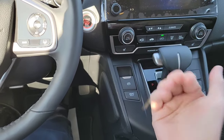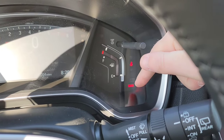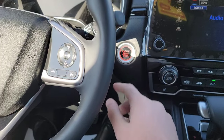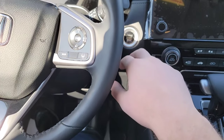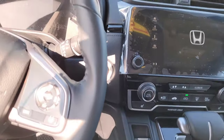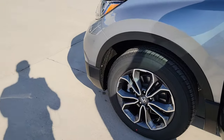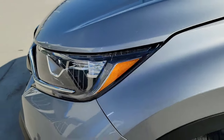Simply put your foot down on the brake and pull that up towards you. You'll know it's on by the red writing down here below — it's going to say 'brake.' Now from there, we're going to stop the car. We're going to wait a couple of seconds — one, two — then we're going to turn it right back on. Now your daytime running lights should be off. No longer daytime running lights.